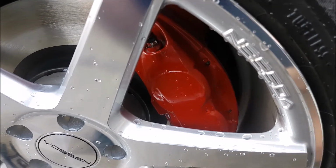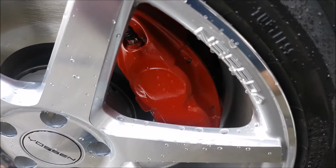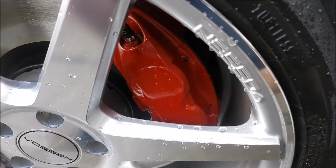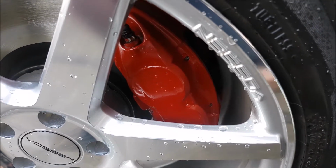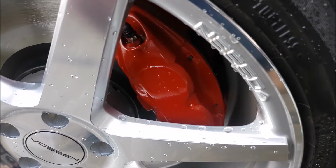In the beginning of the video, I got you guys to start pushing it 10 times, and you heard me say 5. Towards the end, it was just 3 pushes because we were getting brake pedal immediately, so there's no point in pumping it that many times. Like you pump it 10 times every single time if you want a good leg workout, but we only did that initially because there's just so much air in the line. We wanted to attack as much of it as possible.